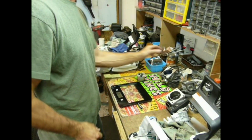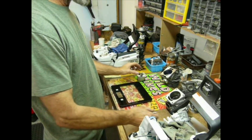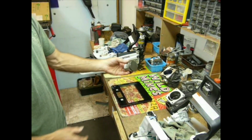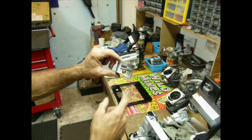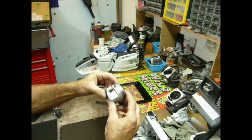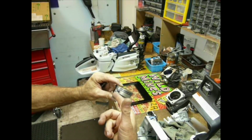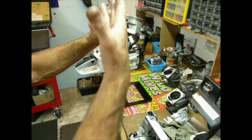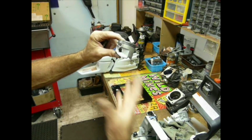Okay, so now we're going to get down to the pistons for a second. One of the things that I looked at, we'll look at the design of the piston real quick. The fresh air is coming in right here. There's a dead port right below the bottom ringland, and we're stuffing raw air into the start of the transfer port circuit. It comes down, it loads up, it's creating a vacuum in there, I guess, essentially, and goes up. It's trying to stuff the raw air into the start of the transfer port circuit and create that barrier.